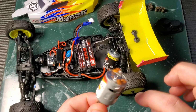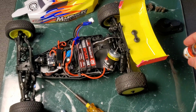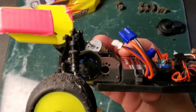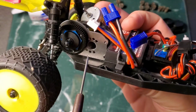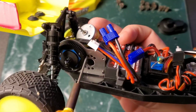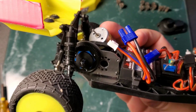Now I think that the gearing on this motor that's faster with the same pinion might be overgeared, but the Mini-B motor mount system, you can see that there's just a couple of holes here. And I found that if you mounted it at this lower hole, it only seemed to take about that 18 tooth pinion, maybe plus or minus a tooth, a 17 or 19.